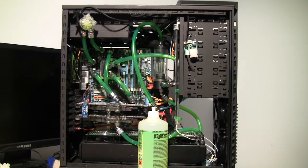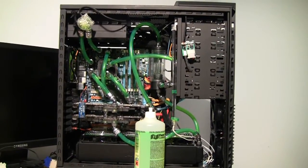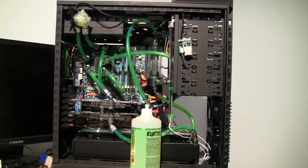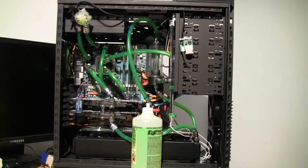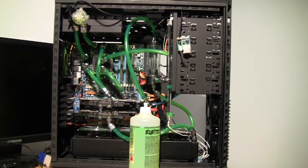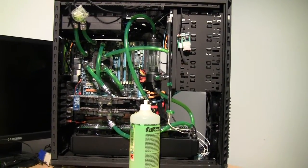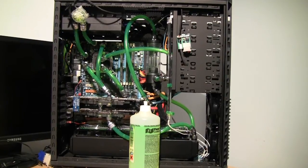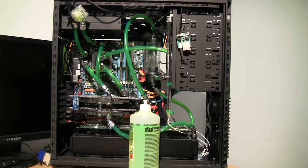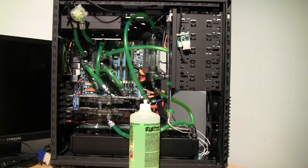Here is a build I finished about six months ago, and I would like to do some minor modifications to make it less cluttered and achieve a cleaner look. Along the way, I also want to check if there is any garbage accumulated in my CPU block and clean it if necessary. There are certain reports on the forum saying that Feser One can coagulate — some goo appears inside the block or tubing — so I want to check what's going on. Six months of everyday use should show pretty well what's happening.